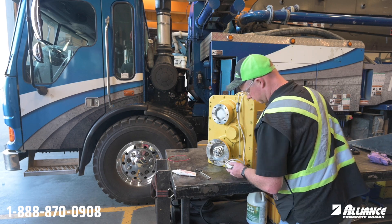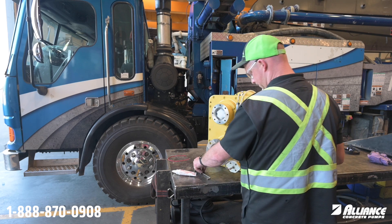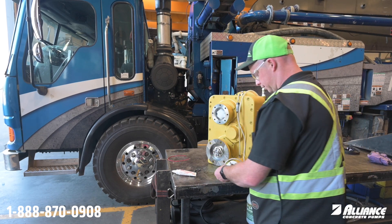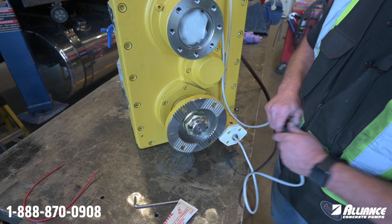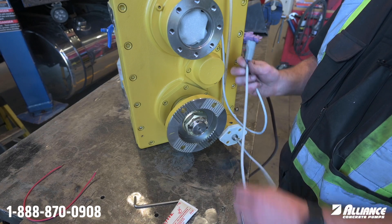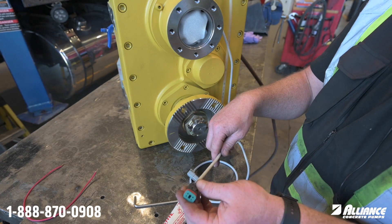You can see there's not much in-and-out play that you have. I'm going to put the cover on and show how the engagement and disengagement works. If you have an issue with your sensor and it's not lighting up — say there's an electrical problem or the sensor has damaged wiring — what you can do is unplug it and discard the sensor side, but keep the truck side.